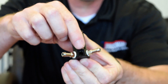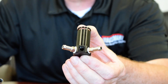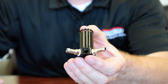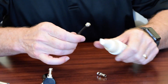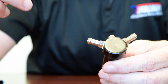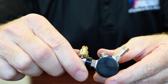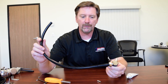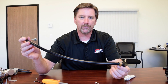You'll notice there's a third port available. This third port is for additional accessories you may want to install on your truck — it makes an excellent boost reference source for a boost gauge, a methanol injection controller, or anything else you can dream up. For this installation we're not going to use that port, so we'll use the included blank-off plug. Now take the reinforced hose and worm gear clamp and pre-install it on the barb. The length of hose included should be about four inches too long for your application, so just cut it to length — we made sure there was a little extra in case you want to run it in a different direction.